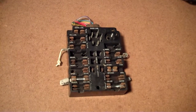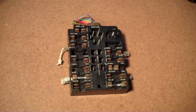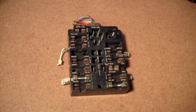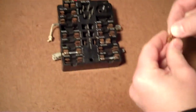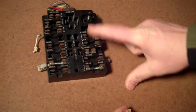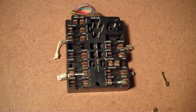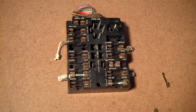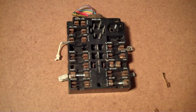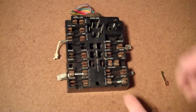Hey, thanks for watching. I want to talk a little bit about fuses and the clips that the Ready Rad comes with. Most older cars will have this type of fuse panel — this is a common fuse panel from into the late 70s. Later they went to the color-coded fuses, which are known as ATC, ATO, or ATM. These are AGC — automotive glass — fuses.